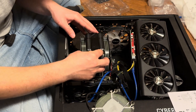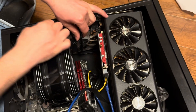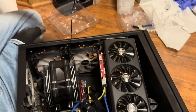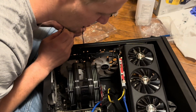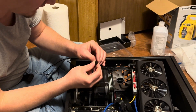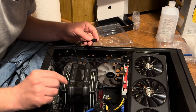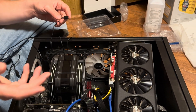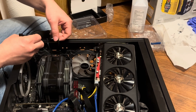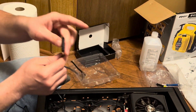Now put the cover back on — don't forget to do that. Next, take the wires and do your best to do some really good wire management. With this being a mining rig, I kind of already have wires going everywhere. The next thing you want to do is plug the CPU fan wire into the CPU fan slot on your motherboard — every motherboard is different, but mine is up here at the top. It should plug right into the board. The next thing is a SATA hookup.